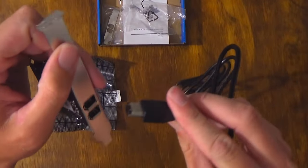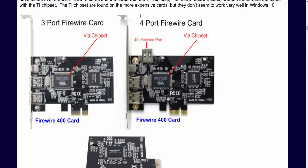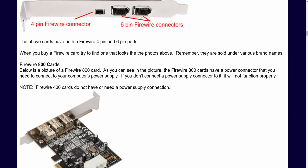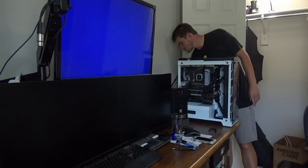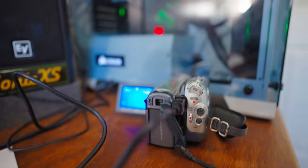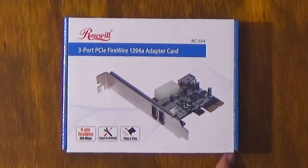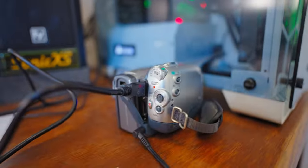Most brands advertise far more performance than the chipset is capable, placing multiple Firewire ports on a single card, which is convenient when you have multiple devices to plug in. But please understand that you won't be able to get more than 400 megabits per second, and you will have to share that speed between your devices. This doesn't matter for our use case because we can only capture one tape at a time. I have bought two Firewire cards — a Texas Instrument and a VIA. My Sony Hi8 camcorder worked with the Texas Instrument card, but the Canon MiniDV camcorder only worked with the VIA card. The VIA card was cheaper, so I suggest you save some money and purchase the card that will work with all your devices.